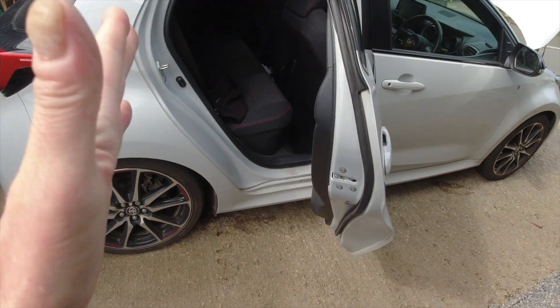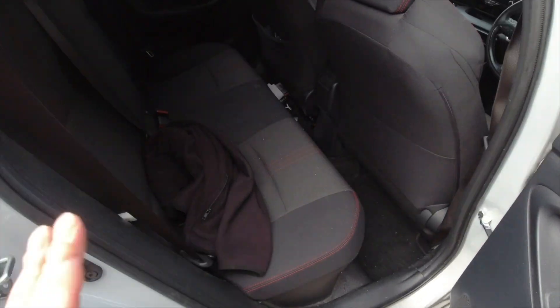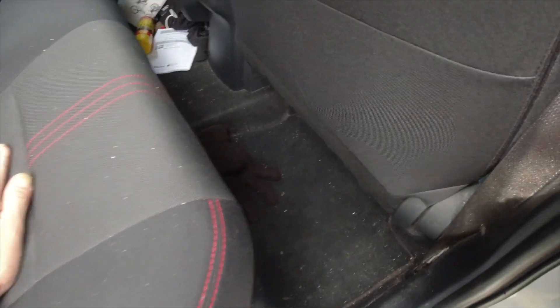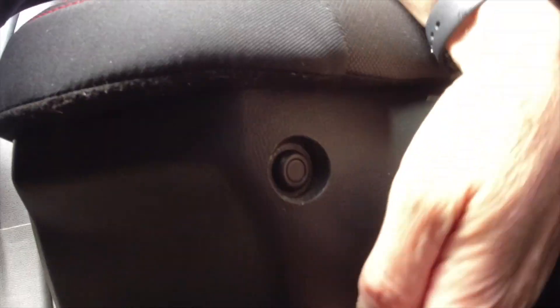The other option you've got is — as I've done — driver side rear door open, you're in the rear compartment. Now the seat, and underneath the seat this plastic panel is removable. There are two little push pins; if you take the push pins out and remove this panel, you will see the battery in here. I'll get the footage out of the other video I made to show you where the battery is.